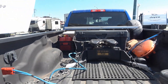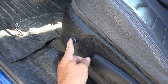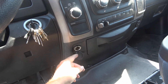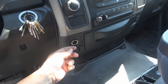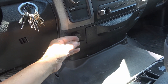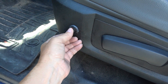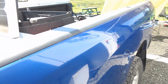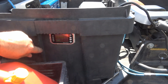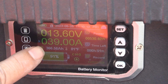Let me demo that. I installed a little switch down here - see that red light comes on. It's connected to the power coming out of my lighter socket, so even if I forget to turn the switch on and off, when the truck turns off this turns off within about 20 seconds so I wouldn't be draining my batteries with the DC-to-DC charger. But I like having the switch as well. When I turn it on, the trigger wire runs down under the truck and pops up here into the box. And you can see I'm charging at 40 - or 39 - amps there.